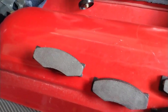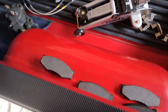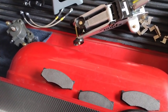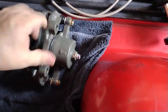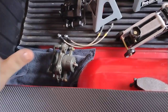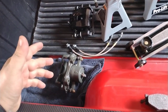Today I'm just going to replace the calipers, the brake lines, and throw in these better brake pads that already came with the truck. I still have the slotted and cross-drilled high-performance rotors and their brake pads at my apartment - since we're going into winter I'm not going to slap the rotors on today. Whenever I do the rotors I'll unbolt the caliper bracket and move it out of the way because you need to do that to pull off the rotor. It's a two-piece rotor-hub assembly where the hub holds the bearings, and six bolts bolt that rotor onto the hub, so you don't even have to replace the hubs, just the rotors.